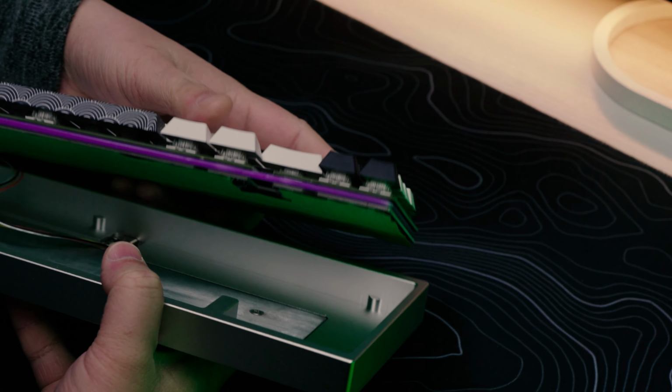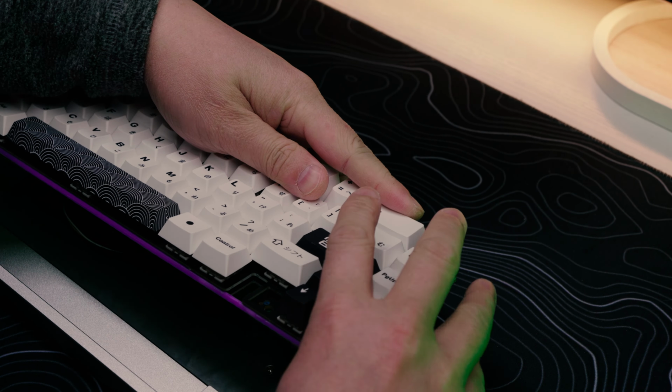Now let's talk about some of the cons. It has poor flex. This is partially due to the small notches on the bottom of the case that keeps the assembly from sitting too low, but it definitely impacts the flex. In comparison, this is an EK68, a gasket mounted keyboard that has a good amount of flex. And then this is the Akko Spring 67, a spring mounted board that has a crazy amount of flex and has different spring sets with different weights for different levels of flex. Of course, flex isn't everything, but if it matters to you, don't be surprised with this one.